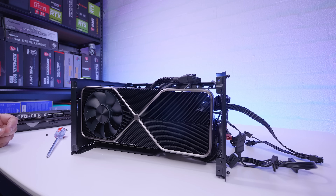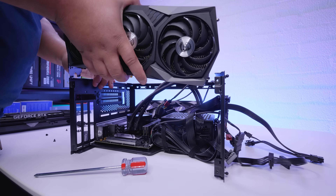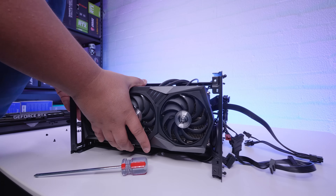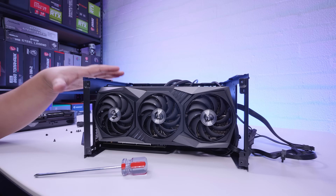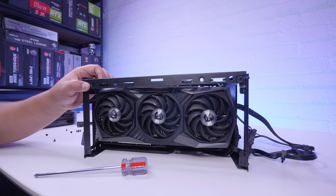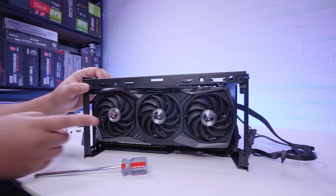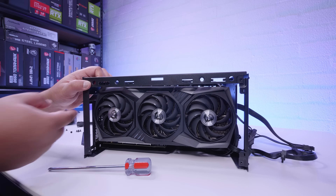Last but not least, let's try the wider card — the MSI 3080 Gaming X Trio. This card's a lot wider than the other ones, but with a bit of luck, this one also fits too. So that's really the crux of this video — whether or not these GPUs can fit. The answer is most definitely they can, but you will need to remove these bottom brackets. Can you mount fans on the bottom panel? Even 120mm fans will not fit there. You can go ahead and deshroud your GPU if you want, but I don't recommend doing that. It does actually fit.